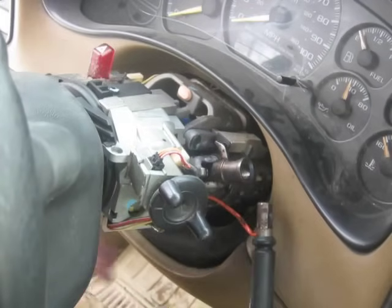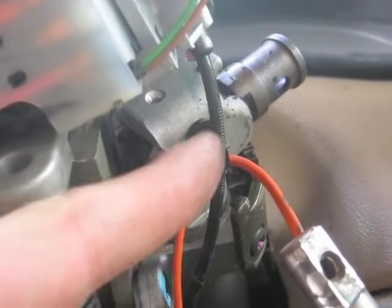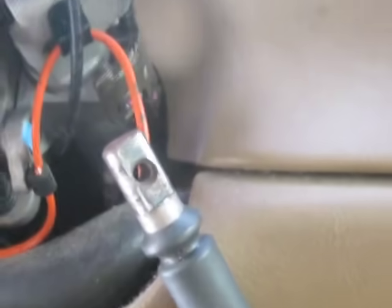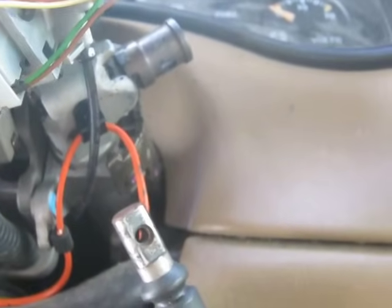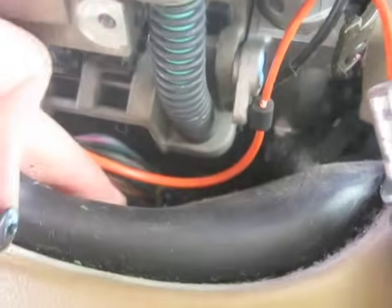You've got this orange wiring harness that snakes underneath the steering wheel. The wire is held by this little clamp here, it comes down, clamped here, and then it goes through a couple of zip ties, and then the harness is right there. You would unplug that harness, snake that out, and that's really it — that's the only thing keeping that shifter together. So if you need to replace it, just take out your T30, undo your wiring harness. You probably won't even need to take this bottom panel out.